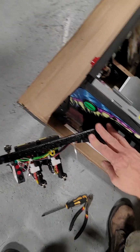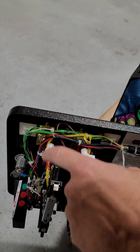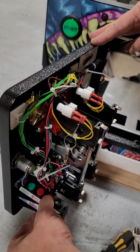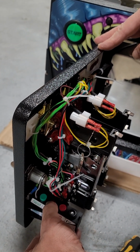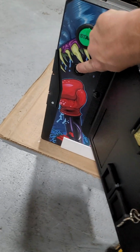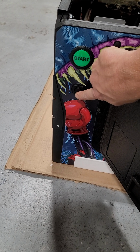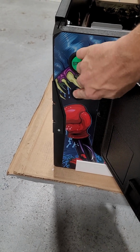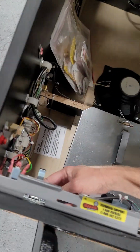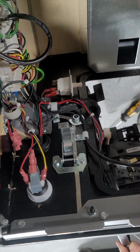All right, so I did rewire it. So basically I had a zip tie, zip tie, zip tie. You then check it again, make sure your up's working, down's working. I have it nice and clean. I'll cut these obviously, and then up, down. That's it, you're all set. And then just again, make sure your wiring is all nice and clean here. It doesn't get pinched anywhere, and that your latch is not interfering at all.